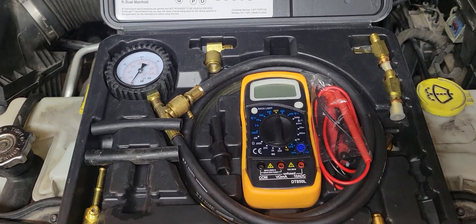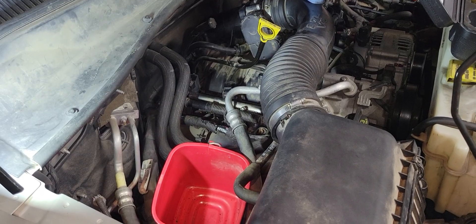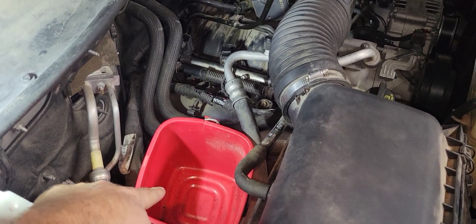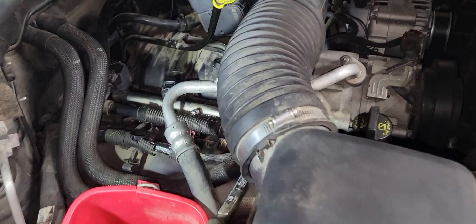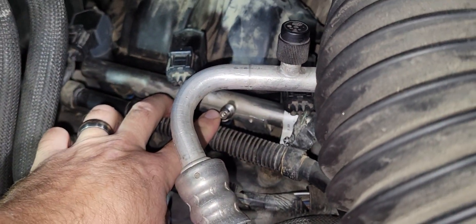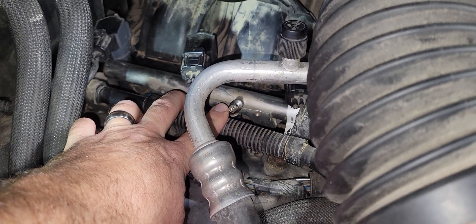Here are the components. All we're going to need is this one gauge with this current fitting. It's good to have a bucket for drainage when you need to relieve the pressure valve. We're going to attach to the Schrader valve right back here on the fuel rail, which usually has a dust cover, but this one's missing. We're going to screw it right into that.